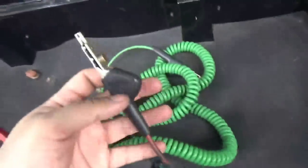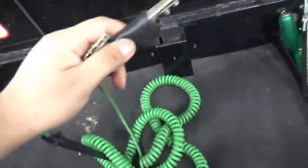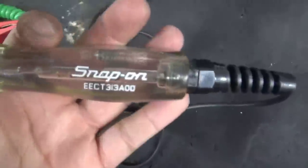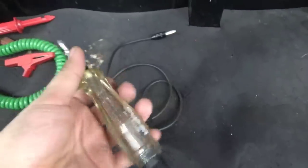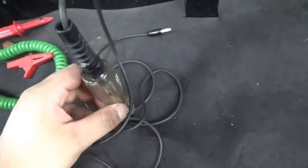You can just use this nice little jumper cable to test power and ground, or anything you need pretty much electrical-wise. Some alligator clips — the Snap-on EECT313A00. It's a test light, but you can also use it to go in between your meter when you're doing voltage drop tests.